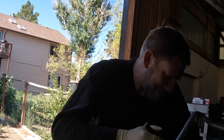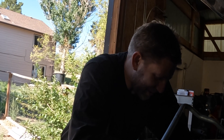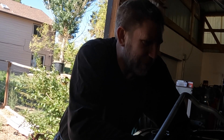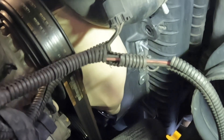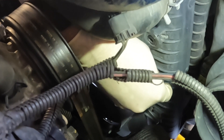If you've got a reason to take this apart, take the time and make that modification while you have it in pieces. It does make this part of the job less obnoxious when you have to remove the fan. You can see where this shroud has been modified — it was cut across here and then strapped across the cut to allow it to be disassembled in the vehicle. This allows the top half of the shroud to come out while leaving the lower half in place.